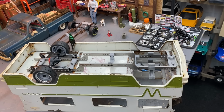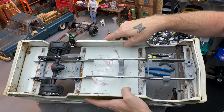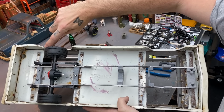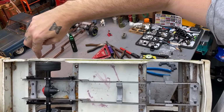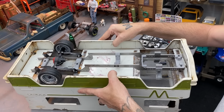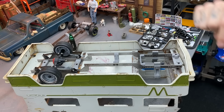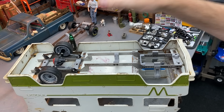Now, there is still room to cut. So we've got the side pieces here, and those still have a quarter inch lip. So you could, if you really wanted to, come back and grind this out. It's gonna start getting close to that body line, so you have to be real careful. I did my best to cut that nice. I drilled holes in the corners first so we get at least a nice rounded edge. I took more than I needed.